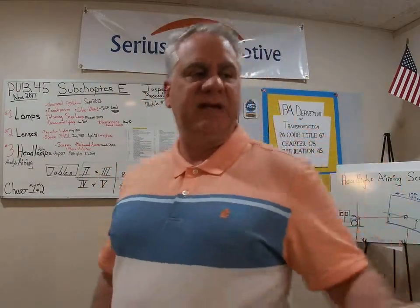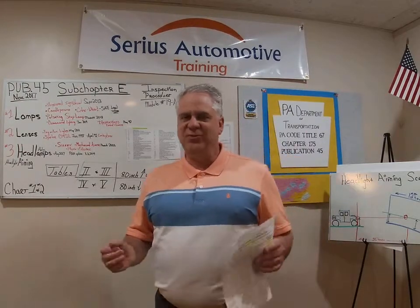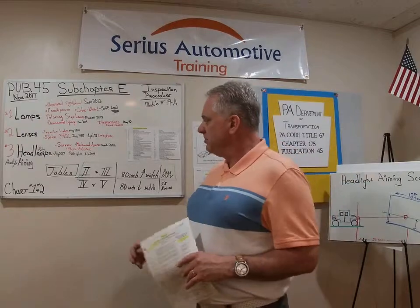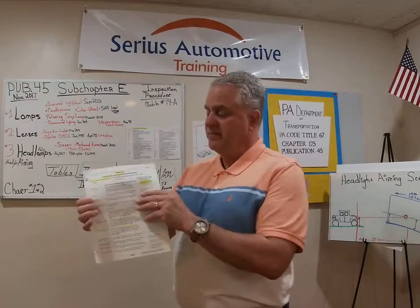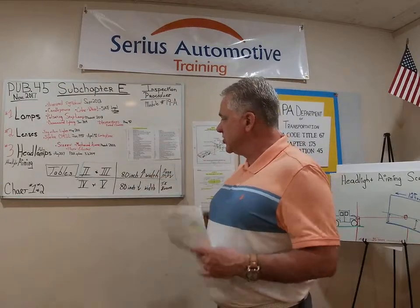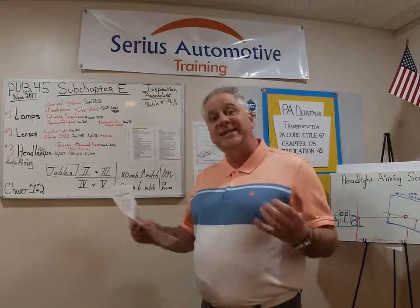In the back of the book we have two charts I want to refer to. The vehicle I drive is a Hummer H2 — I was a shop foreman at a Hummer dealer in Flemington, New Jersey, and also worked at Patankin Hummer Cadillac in New York City. In the back of the book we have Table 2 and Table 3. Table 2 is required equipment for lights; Table 3 is the location. Tables 2 and 3 go together; Tables 4 and 5 go together. Tables 2 and 3 are for an 80-inch-or-wider vehicle — a multi-purpose passenger vehicle like my H2 — and the light designations are different.